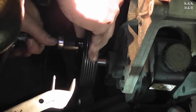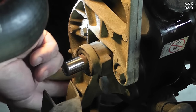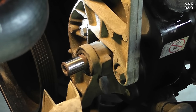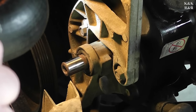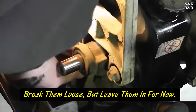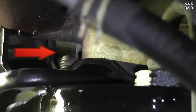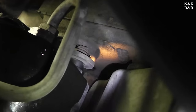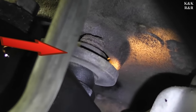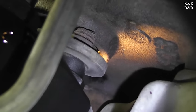The pump pulley is off. Now the thing we're going to attack is the mounting bolts — one, two, and three. Normally people would take the hoses off first, but I'm not going to. I'm going to disassemble the pump out as an assembly, because with the back pressure and a very tight fit, even with a flare wrench you still run the risk of spinning it. So let's get the pump off. I'll zoom in on the first stud — there's no way to get a wrench on it, and the other one by the block is right on the freeze plug. There's no way to get a wrench in there regardless of how small your hands are. It'll actually be easier to pull this off as an assembly — it'll at least give you a handle to grab.